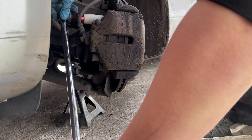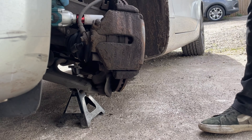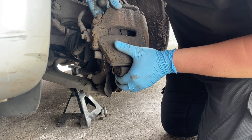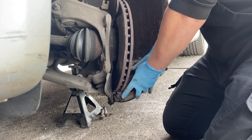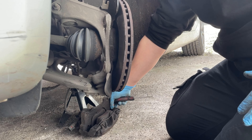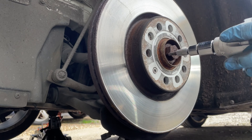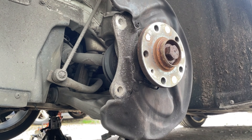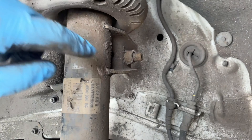I'm going to use my 21mm socket to get the two bolts off the back of the caliper hanger, take the bolts out, get the caliper out, give it a really good wiggle, and then swing it straight over and put the caliper on the floor out the way. Next we'll straighten the wheel back up and use a T30 Torx bit to get the bolt out of the disc to get it away from the hub. Then we need to get the drop link off.